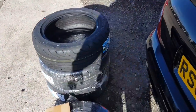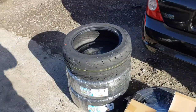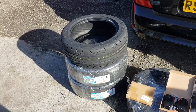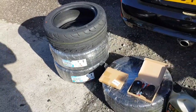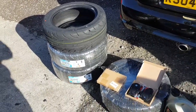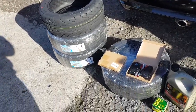There's our tyres, and we've decided to go with, it's actually a budget tyre. You might be surprised to see this. Normally we use an ER1 or a 888, but these here are getting really good reviews, and honestly they're peanuts. So these are Accelera 651 Sports semi-slicks. Believe it or not, 195/50/15 in these tyres here. They cost us 43 quid each, so it's absolutely peanuts.